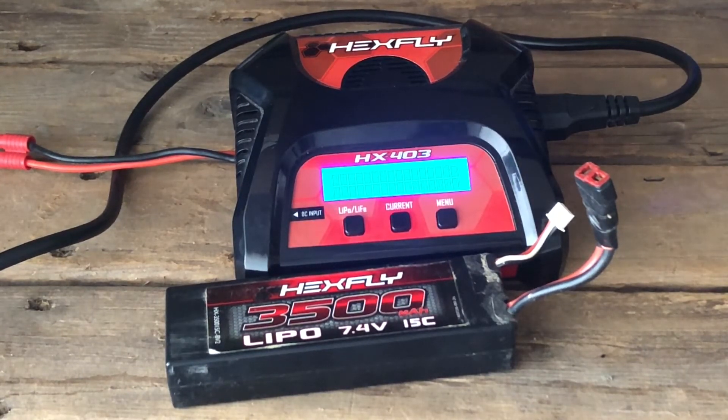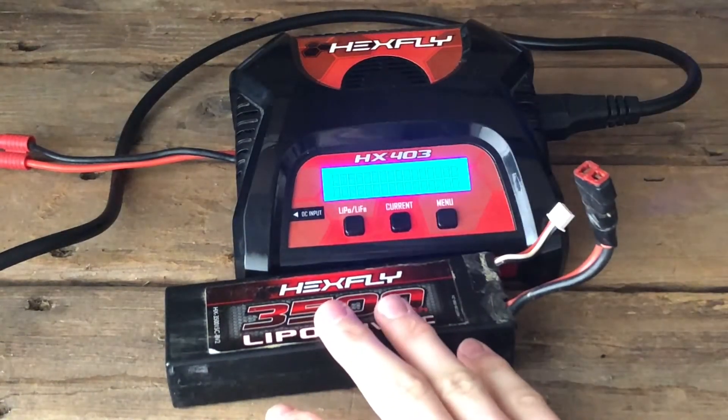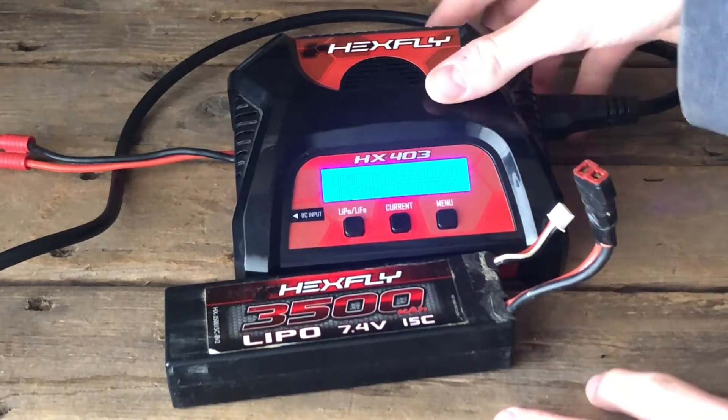They're just overall dangerous. Environmental pressures change in the atmosphere and can affect the battery in ways it doesn't like — especially when fully charged. At a storage charge level, a pressure difference might not change anything. So storage mode is the best option: it discharges slowly and won't drain fast since it's already at around 75%.